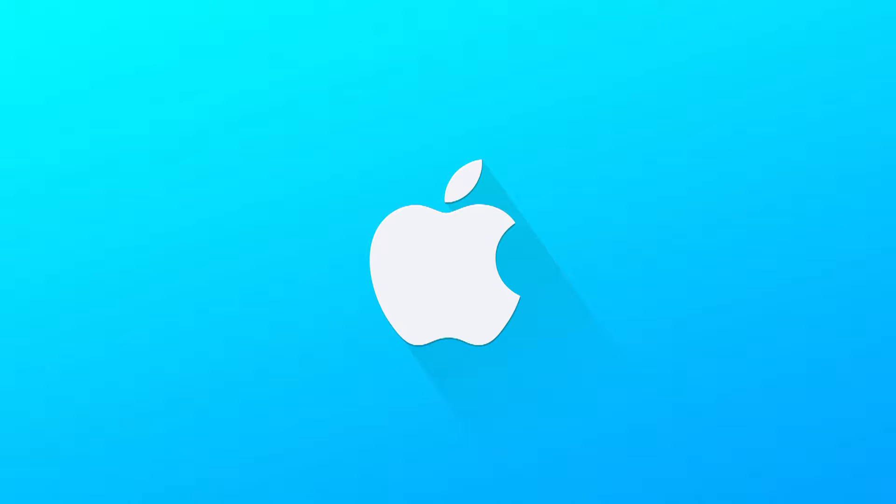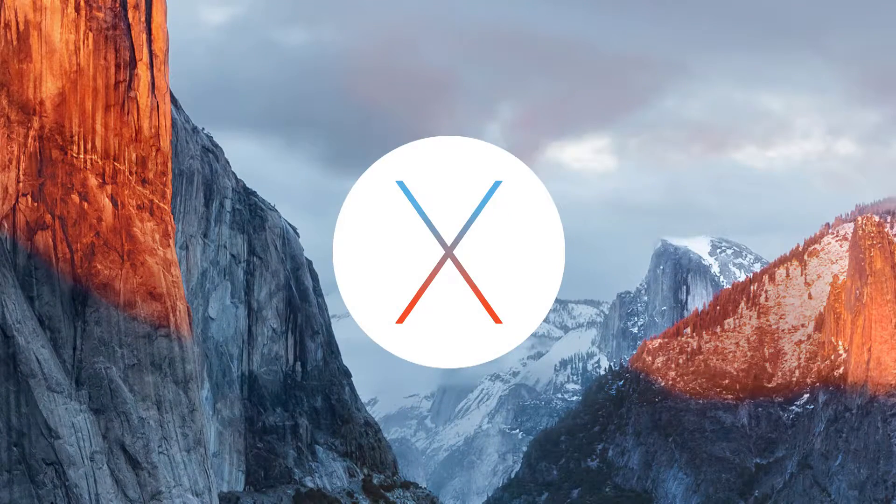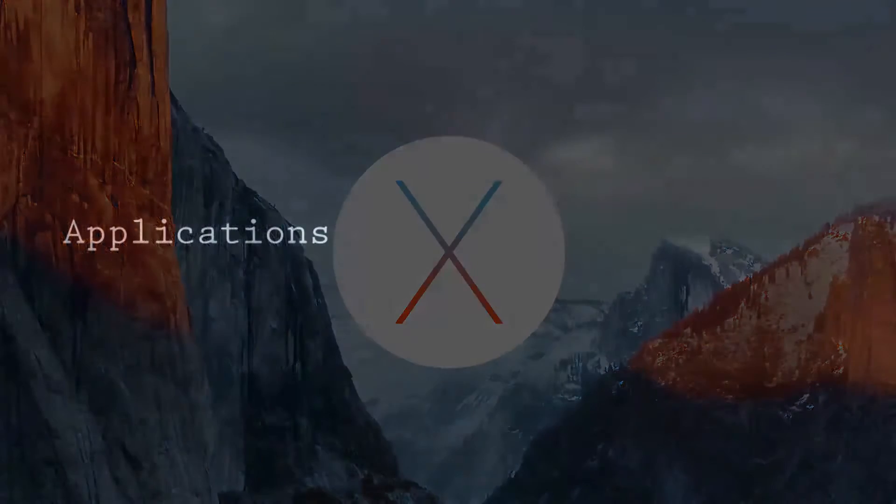But with the advent of El Capitan, the tools for creating a RAID were removed from it. So from here on out, I am going to be describing the procedure using El Capitan. First, let's go to our main boot drive and open up our Applications. In Applications, there is a folder called Utilities. In our Utilities, there are two programs we need to run: Disk Utility and Terminal.